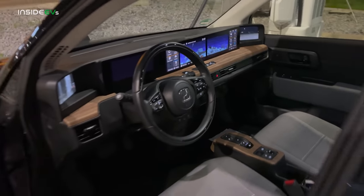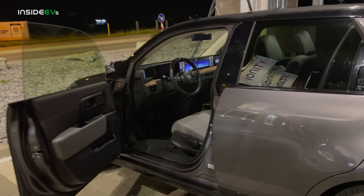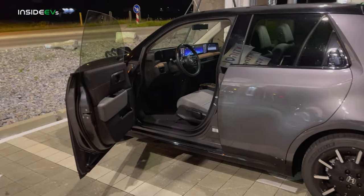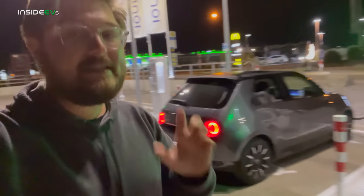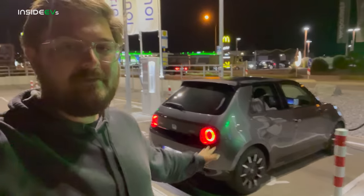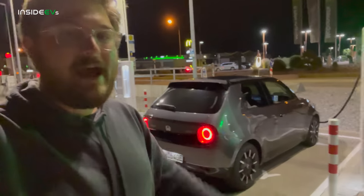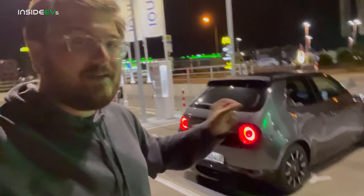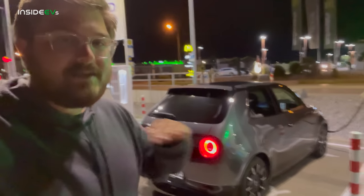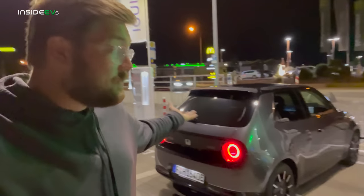You can see the shifter down here — it's such a cool car. I'll have a full review again on this later, but today we're just focusing on the range. One of the reasons I do the DC fast charging test right before the range test is it allows the car to select its battery pack and drivetrain temperature. This has a liquid-cooled battery pack; it's cycling on and off the AC compressor to maintain its optimal pack temperature.